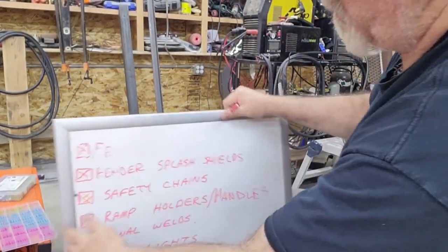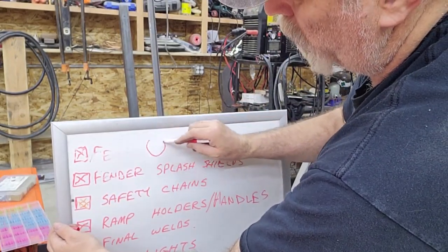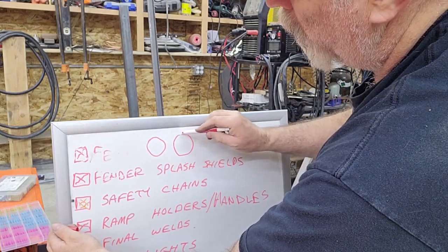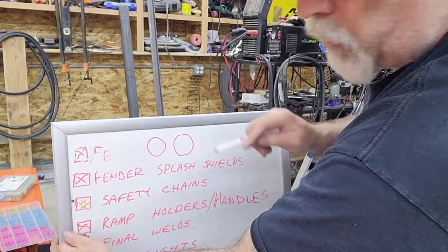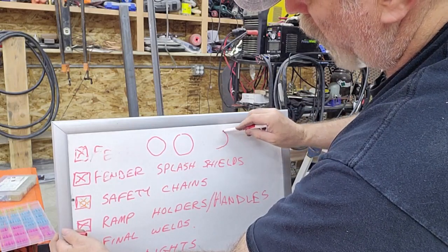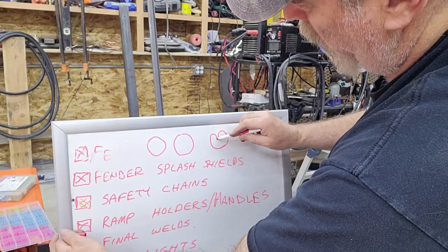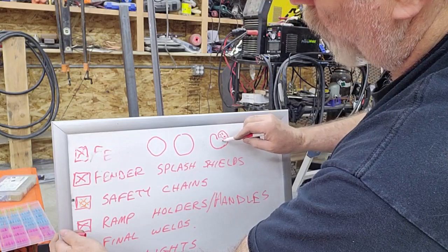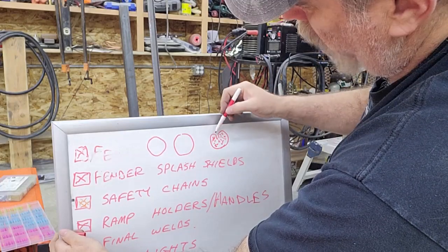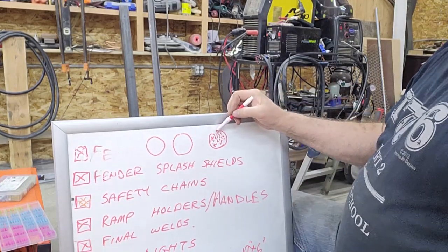So this would be looking at the butt connector from the end. Normally they start out round, but every butt connector that's manufactured actually has a little tiny joint there where they're not touched. So if you use that style of crimper that I showed you, when you crimp them, you end up with a crimp like this, where it rolls that in. So this is an end view, the cross section of the wire would be in here. And then you can move it to the secondary jaw and squeeze them again, and it makes a very tight crimp. That works fine on non-insulated terminals.